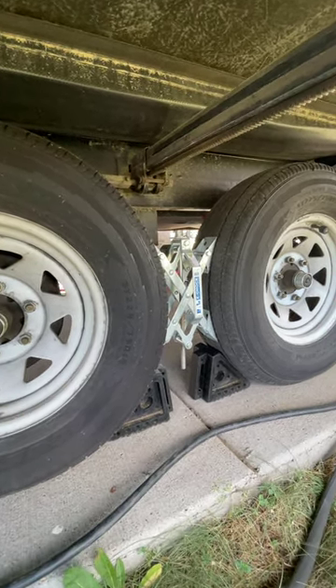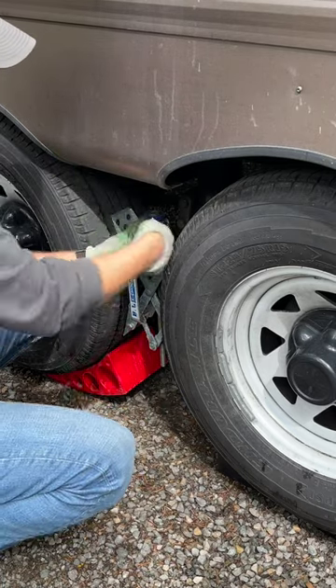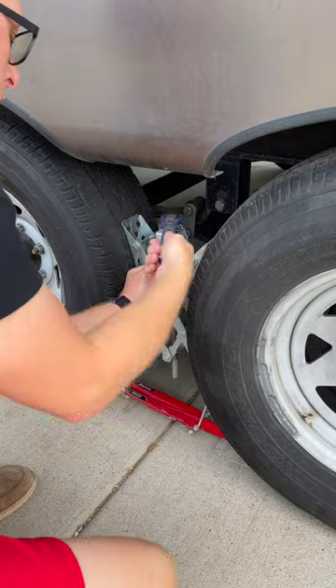Since you have to place them after the rig is level, you'll definitely need regular ground chocks to hold the rig so that you can uncouple from the tow vehicle. BAL also recommends coming back after your tires have cooled down to add a few more turns into the screw to stabilize the rig.